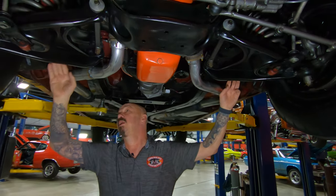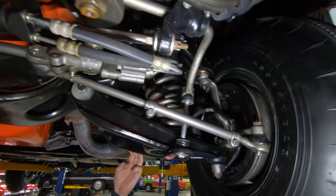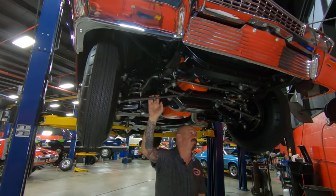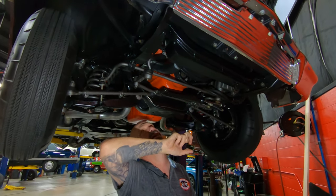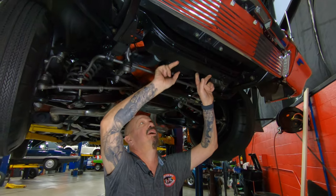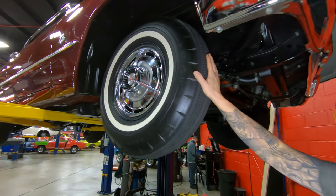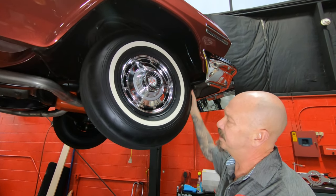The guys will take the brakes apart on everything, make sure they're in good working order. New brake lines here — you can see the primer coat on the floorboards and a little bit of undercoating. It all looks like factory under here. Brand new exhaust, X-frame — frames all painted up looking good. All these brackets and braces are all in great shape. We've got our 4-speed transmission here. Lower control arms, the dog bones — bushings in the dog bones are looking good. All the ball joints look good, the flex lines on the brakes look good. All the steering looks good — it's got that bare metal paint on it so it looks like bare metal just like the factory but it's actually paint so it won't rust up. We've got a sway bar up here and the idler arm looks like it's new.